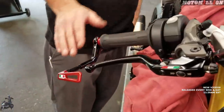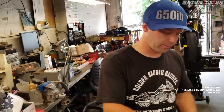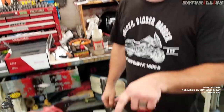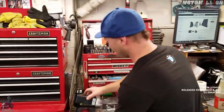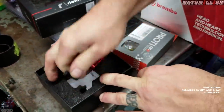We've got our lever set right in line with the brake lever guard, at about the same angle as the clutch lever — though that's all personal preference. Some people like them higher, some lower. Now our next challenge is fitting the reservoir to the bike and making sure we have the same hose size. The Brembo master cylinders come with a 6-millimeter adapter for the hose. Stock uses 8 millimeter, so you definitely need a different piece of hose.